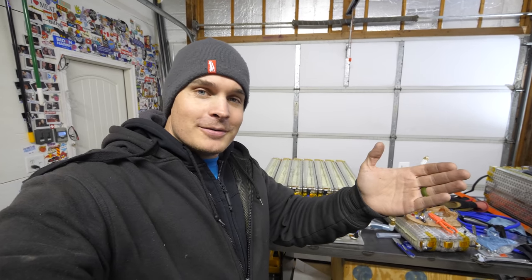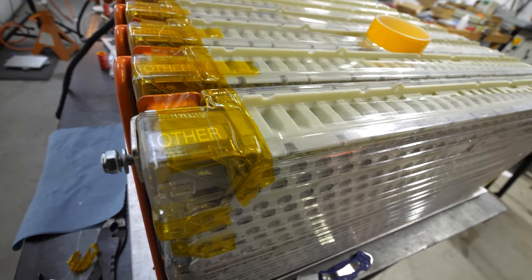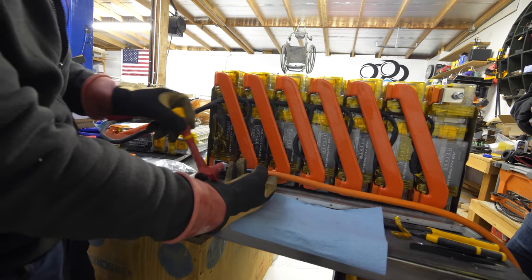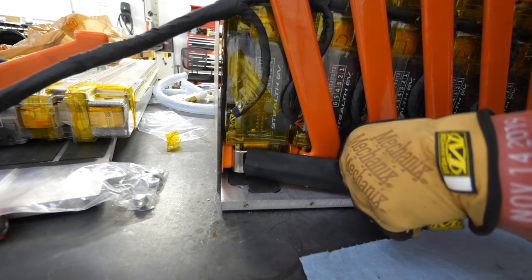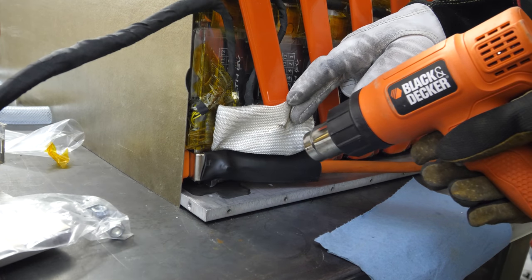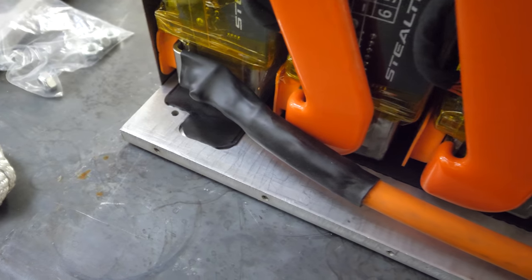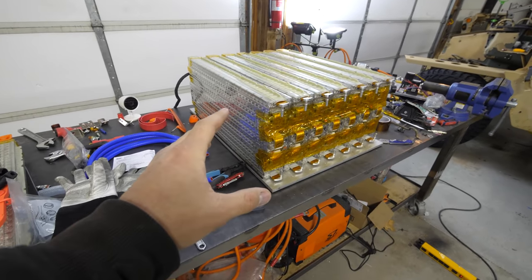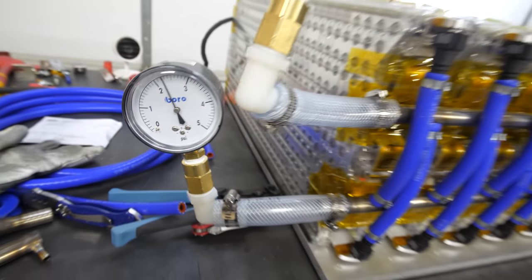Now for the box and putting it in. There was some concern in the comments about the connections being too close to the wall, so we shrunk things in toward the battery and added heat shrink over the connection for one additional layer of protection. Nothing inside the box will ever slide around — the grooves in the top plate keep things from shifting. These seven modules are now sealed, liquid-tested, and pressure-ready. After another 24 hours, the second box has also maintained its pressure and we're good to go.